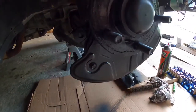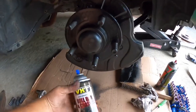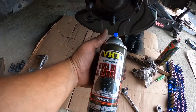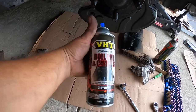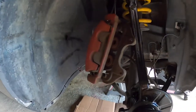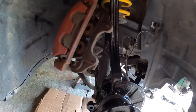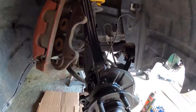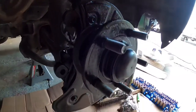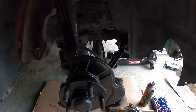But yeah, look — it's nice and clean black again. Basically just wire brushed it. Then I did this VHT roll bar and chassis black. The caliper I'm going to do separately — I'm going to degrease it, wire brush it, and then I have actual black caliper paint that'll be going on there. Nice and clean. I'm going to go ahead and jump to the other side and do the same thing.